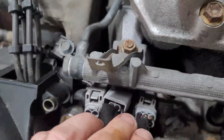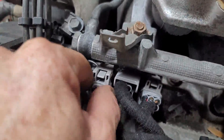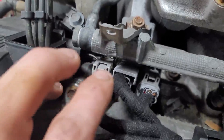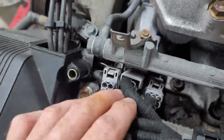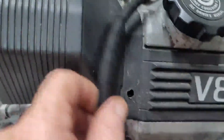On this side, all of your injector connectors have been replaced. The six-pin connector has been replaced — I've swapped it for a four-pin and just need to put two seals in there since I only stock the four-pin. Both on this side of the harness and on your other side, the front section has been replaced with the four-pin.